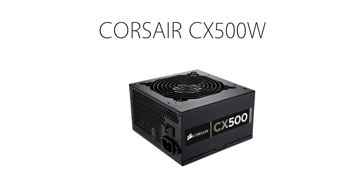Next up is the power supply, and in my opinion it's the most important part of any computer build, mainly because you need power to run your system. Never be cheap when picking out a power supply, because poorly made PSUs can short out and catch your PC on fire. My recommendation is the Corsair 500W power supply. 500W is plenty for this build and can still be used if you upgrade in the future. It's 80 Plus Bronze certified, which means it's a high quality supply that can help lower your power bill. It's also modular, which means you can remove any cables you don't need. You can get it for around $60.